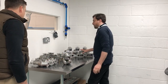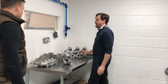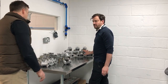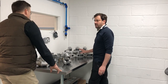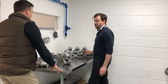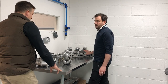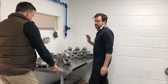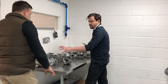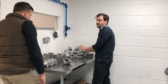On the other hand, the SU is a great carburetor for general use - they're very tractable and behave themselves very nicely if they're in tune. They're also a great sporting carburetor as well. Don't write them off as a pedestrian carb - they're actually quite a sporting carb. Lots of racing cars have managed very well with well-tuned SUs, and they can be tuned by adjusting springs and needles and so forth to respond very, very crisply indeed. So they're not a bad carburetor at all. I don't think there's such a stark contrast as people make out - saying this is a sports carburetor and this is a road carburetor. I don't think that's the case.